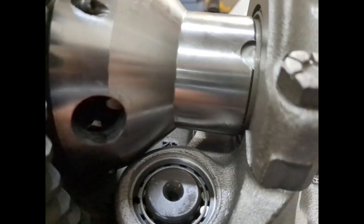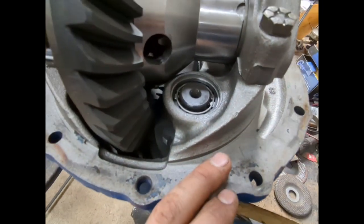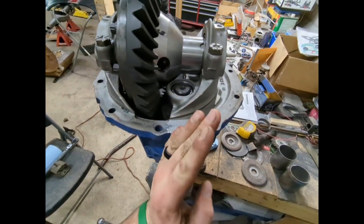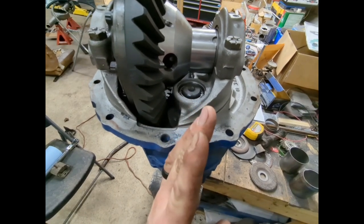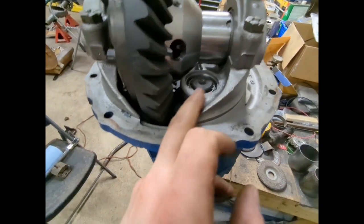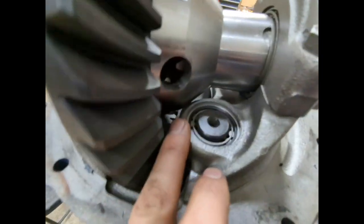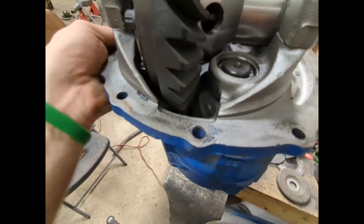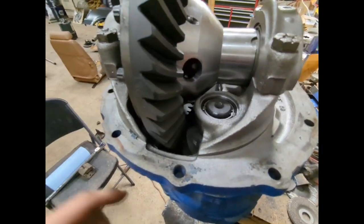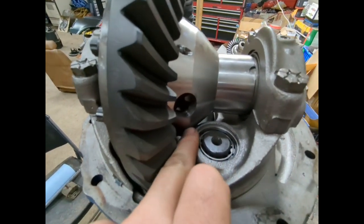I've got a concern that it might sacrifice some strength, but the pinion support bearing — what it's trying to do is keep the pinion from deflecting as you apply torque. The pressure on the gear tries to bend the pinion gear, trying to ride up the teeth. So really all the strength is on this side of the bearing, not really so much there. I'm not going to go crazy — probably take about an eighth of an inch off there. Right now the carrier won't move and we have way more backlash than we should. I think we're going to be fine on this side of the case, so I'm going to start trying to sand a little bit of that away.